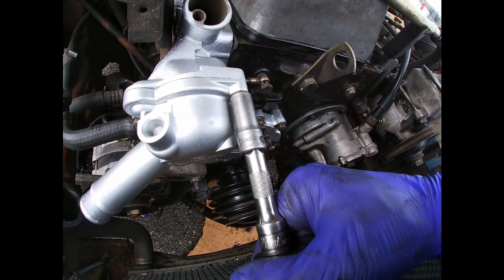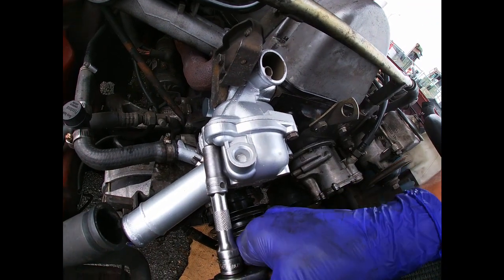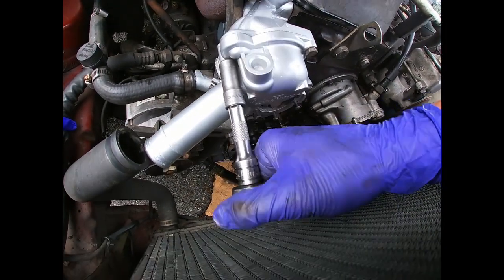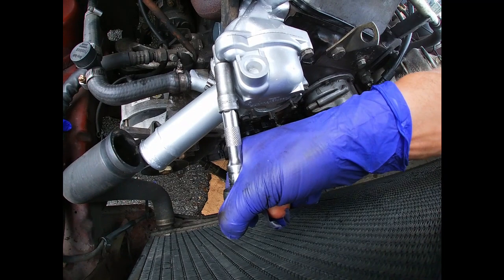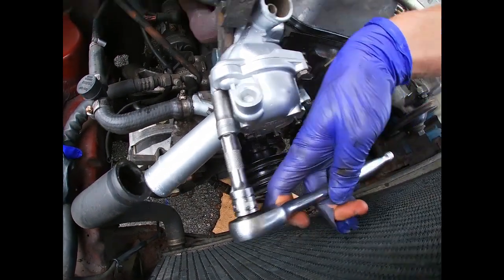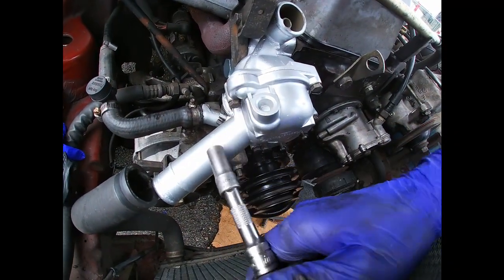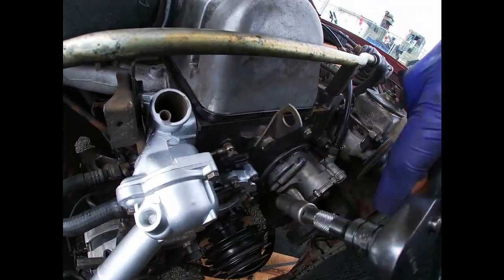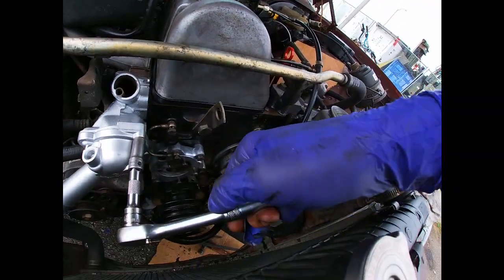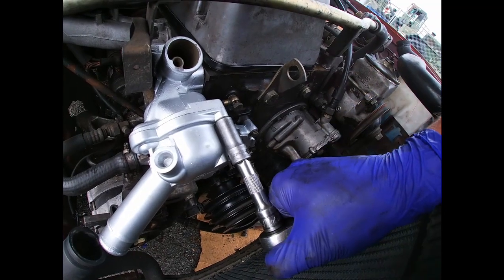You will feel when the bolt stops, so then just give it a little bit more torque, and that's it. And try to hold the ratchet like I'm holding it, because you don't want to hold it at this end, because you want to be able to feel it. If you hold this end of the ratchet while tightening, you're most likely going to break that bolt.